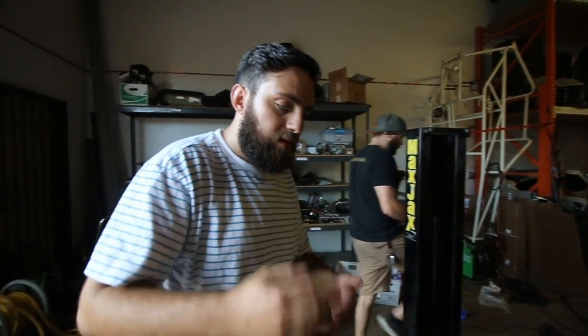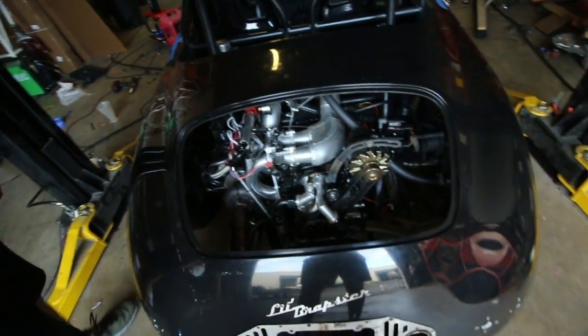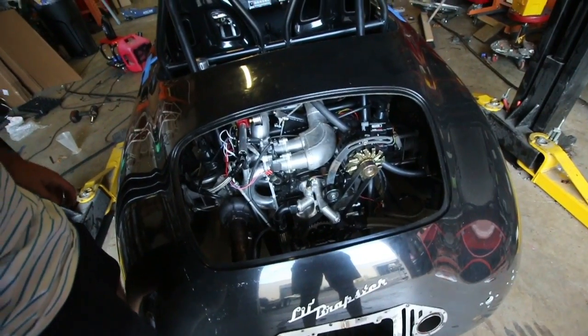It's doing that because it doesn't know what's going on with the engine, so it just temporarily turns off the timing altogether, and a big fireball of unburnt fuel comes out, and then it picks right back up. But it feels like it could be borderline a knock event, so I just don't want to push it. So we're gonna run some shielded wire. Yep.